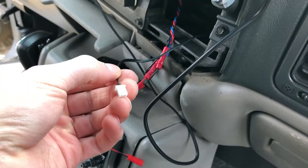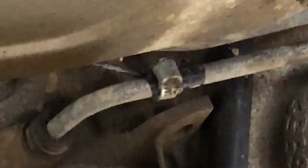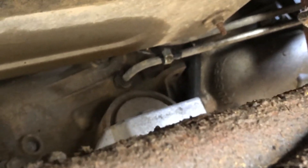This is the wire for the temperature probe. It goes through there, down — you can see it right here — drilled into the floor. It comes out, goes down, and goes to the transmission. You can see the sensor goes to the hot side of the transmission coolant line. It's pipe clamped and electrical taped, and that's how you get your hot temperature reading.